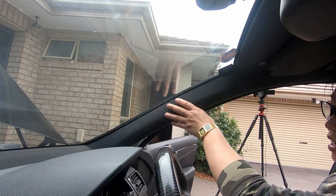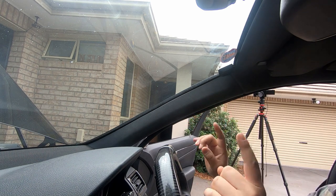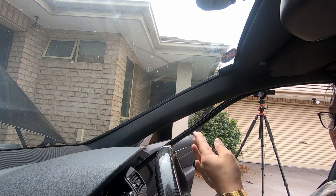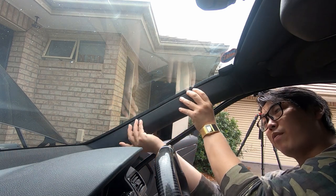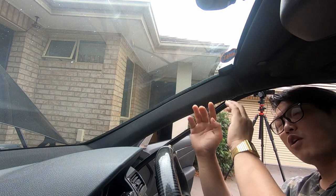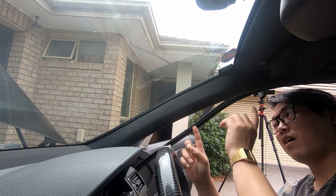To access your A-pillar, there's a clip up the top that slides out this way. Don't try to just pull it straight out — it's not going to come out. Remove your seal, then grip it with clean hands if possible. Pull up this way and a little bit that way, but not too much. It's clipped in that way, so you just want to slide it out. I'll show you what it looks like after I remove it.